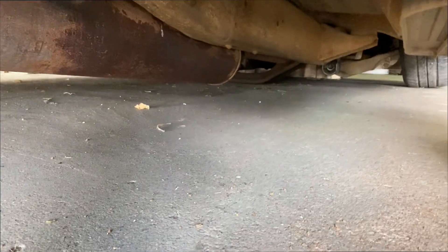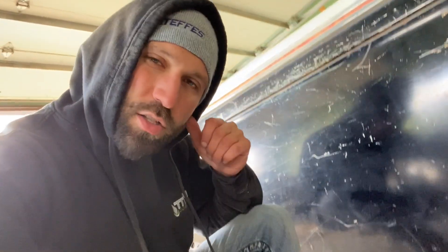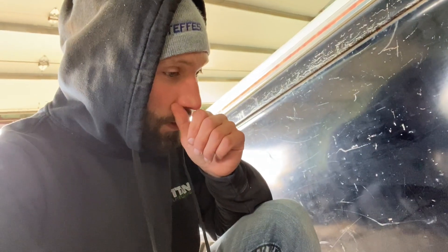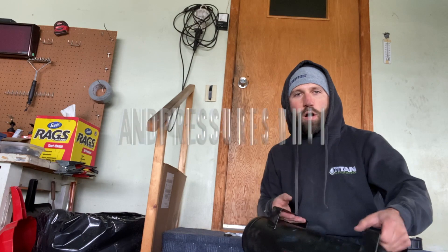Can't wait to get this thing plumbed in and pulled out of the garage. Right now it's sitting on the transmission cross member. I'm a simple man, so I'm just using RTV red on these brackets on this tank and I'm going to mock it up. I've got two jack stands under there to set the tank on, and once I get it positioned I'll push it up to make marks on where to drill the holes — that's the easiest way. I need to figure out which of these ports to plug and which makes sense for where the fittings will go for the airline. I'm going to put in some plugs on some of these ports. I don't have a drain valve for it yet — I was going to order a petcock but it was on backorder, so I figured that'll be easy enough to do after the fact.